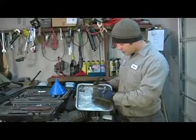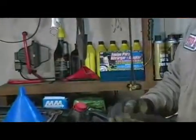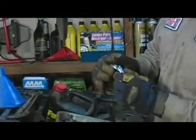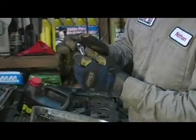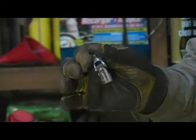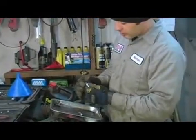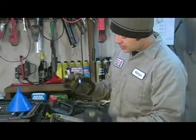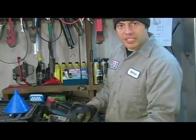And what I have here are some swivel sockets. As you can see here, this is a 3/8. You may need to use one, both, or a combination of them. You can see the angles you get out of these swivel sockets. They allow you to turn your sockets at greater than a 90 degree angle. I got a quarter-inch swivel socket as well. This will greatly reduce the stress and trouble in servicing your radiator.